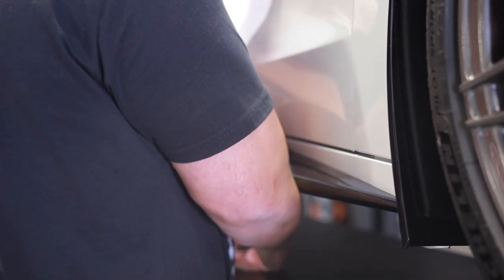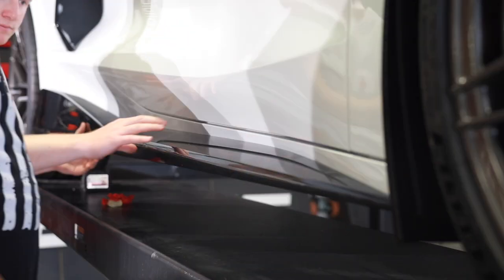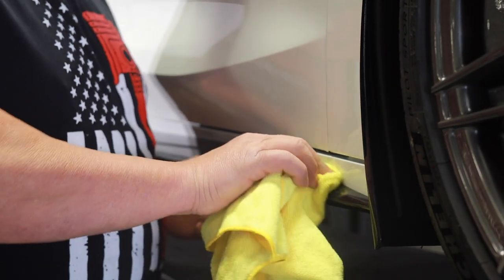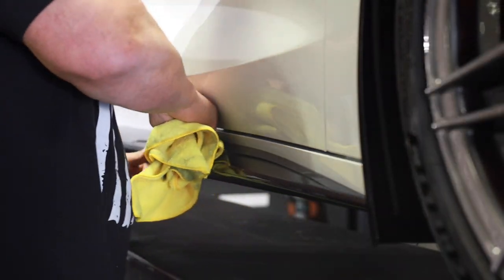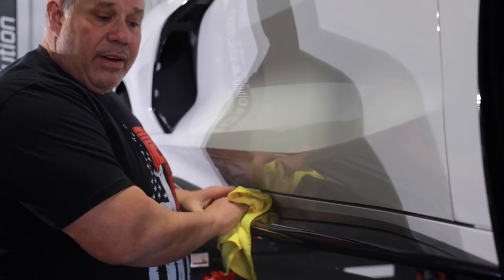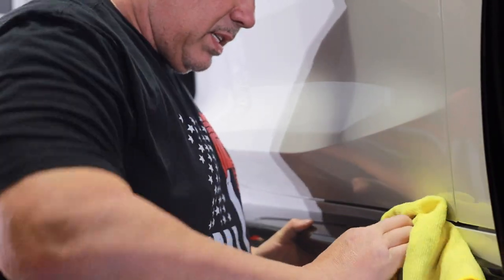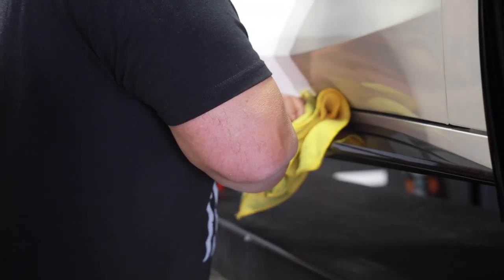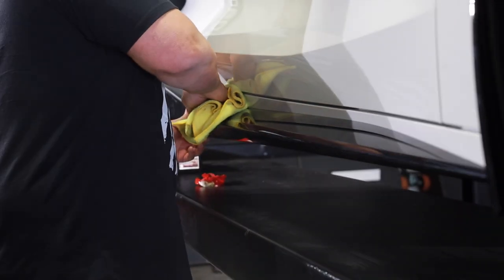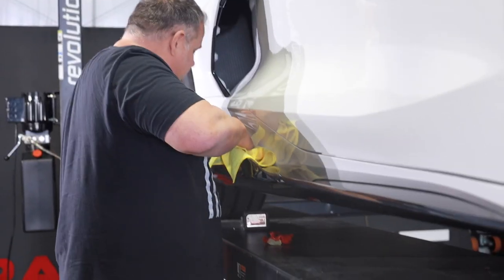I'm putting pressure towards the car and then pushing down on the double stick tape, and it looks like I got lucky first try — thank God, because that would be a mess to have to pull back off. Fit and finish looks good and tight. Again, I'm not sponsored or paid by these people, but ACS Composite did their homework and for an aftermarket part, they fit fantastic. I'm making sure I use a rag instead of my fingers so I don't scratch the paint. The only thing left is to drill some of the holes and put the pop rivets in — but this already feels pretty solid, secure, and safe. We'll tighten up the 7mm bolts and then start on the other side — rinse and repeat.